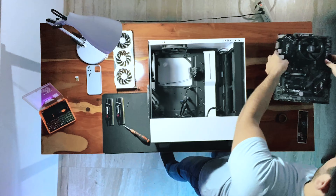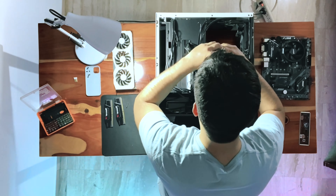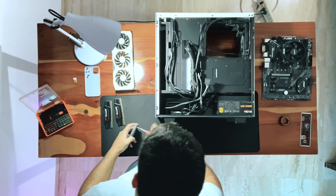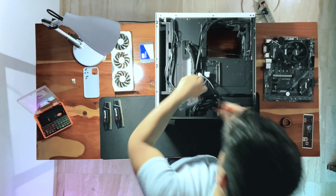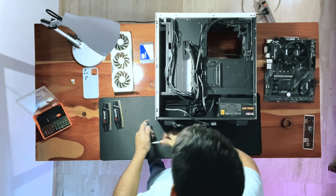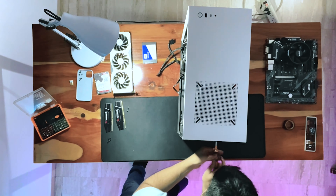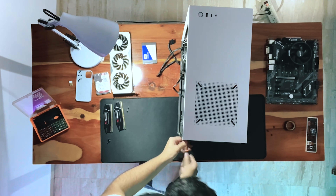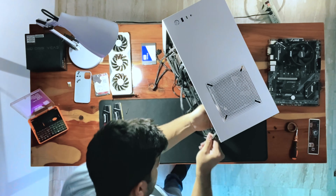After removing all 9 screws, you can take the motherboard out. You really want to put it on top of its box with the anti-static bag it came with, but don't put it on top of the table — you might bend a pin. Remove all your drives from their slots or casings, and you can start removing the PSU from the PSU shroud. There should be 4 screws — put the PSU somewhere safe.